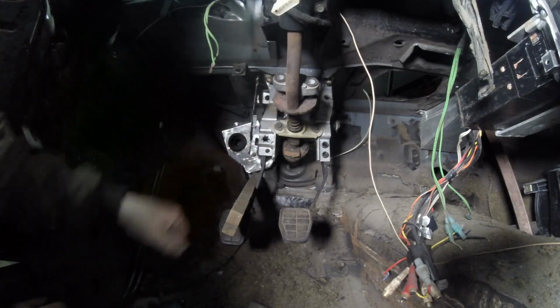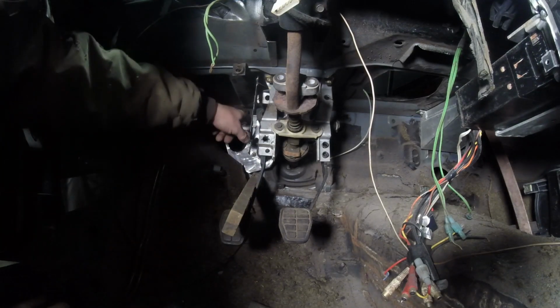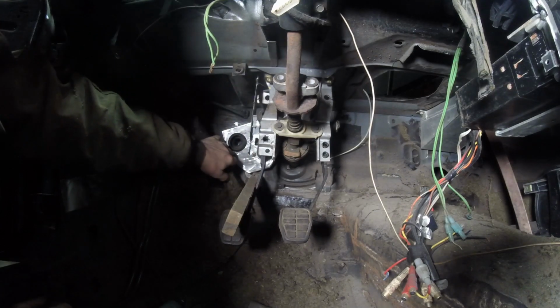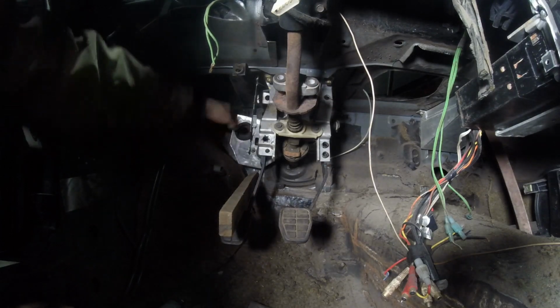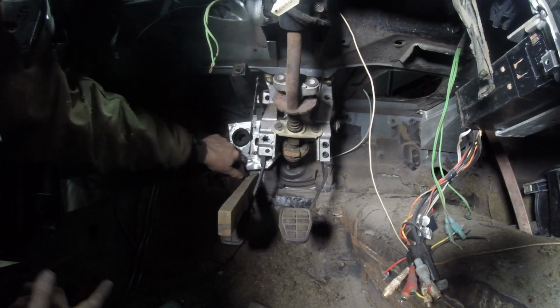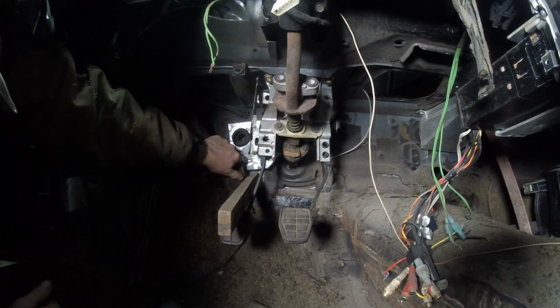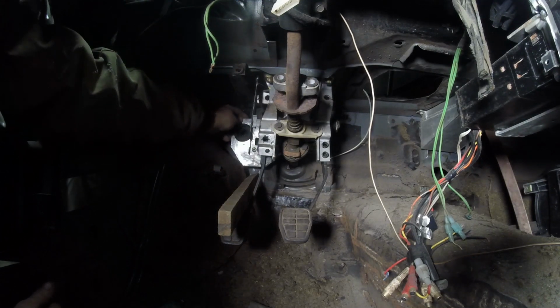I've got to pull this down, which I didn't want to do, but I will. And that way I can clean up the rest of that, get that all squared away, and then start tacking it in. Because we're still going to have to trim more of the internal part over here, but once that's welded in down through here, down through there, I think we can cut it, bend it in, and use that as another part of the section to box out the entire chassis, or the entire box into the chassis.